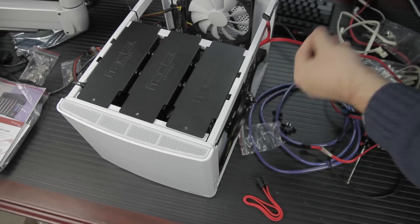Well, you're probably abusing them a lot more than I am. I'm using three three-terabyte Seagate drives, and that gives me six terabytes of usable space. I've been using it for over a year and haven't had any problems. I'm actually kind of surprised this hardware is doing so well, because the motherboard has basically an AMD CPU right on the chip — it's a SoC. But everything's been running just fine, even though it's very much not a real NAS build. It's running at full speeds with two gig NICs, throwing a bunch of video to and from the drives.